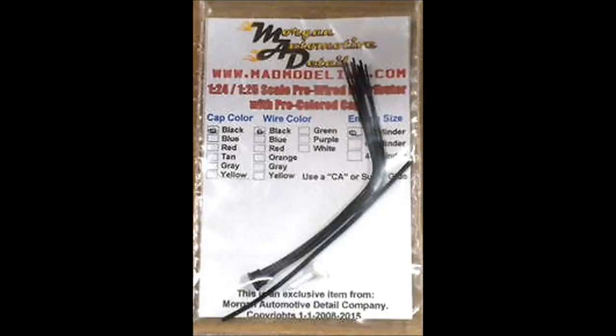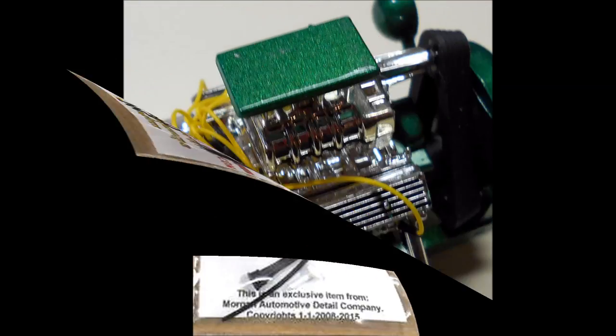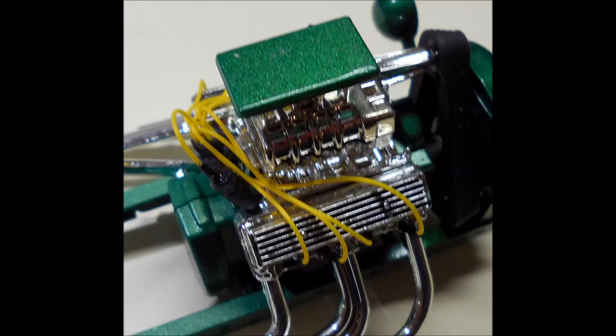There are a lot of different brands on the market, and you can make some at home. Using a wiring diagram from the internet, you can wire the motor by drilling out the hole for the shaft and installing it with some super glue. Then you drill out the locations on the heads for the spark plugs. Cut a small piece of black wire for the boots and slide it onto each wire. Then match the wires up to the diagram and cut to fit. Slide each wire into place with the boot at the hole, then super glue all the wires into place. Add the coil to the center wire and cut it to fit sitting on the motor. As you can see, it adds a really nice finishing touch, especially with the blower intake there.